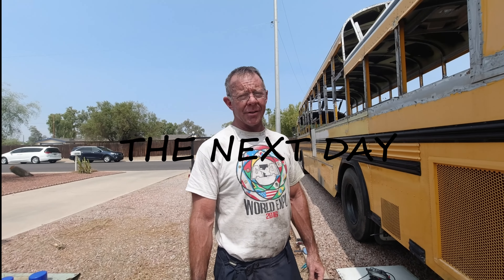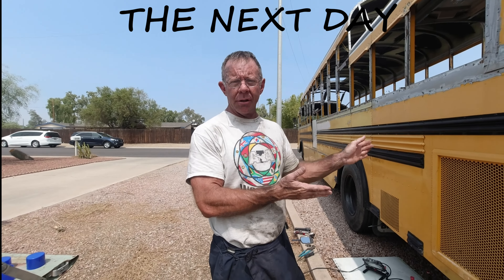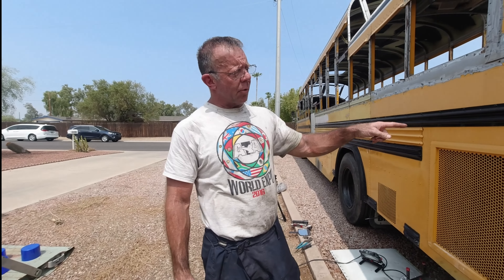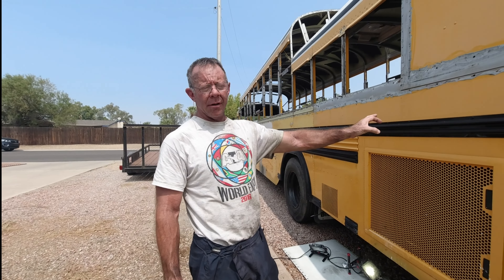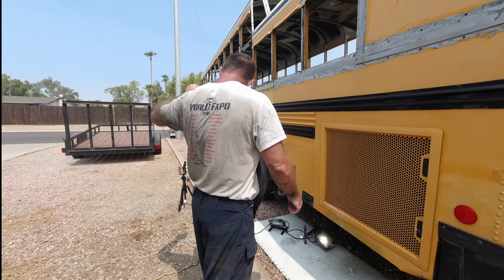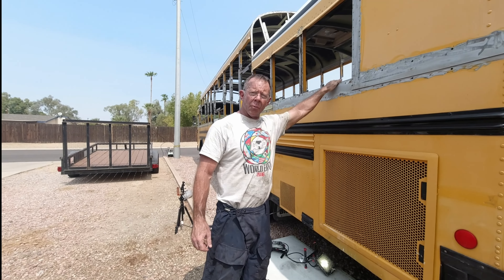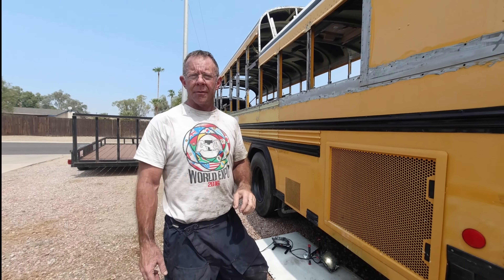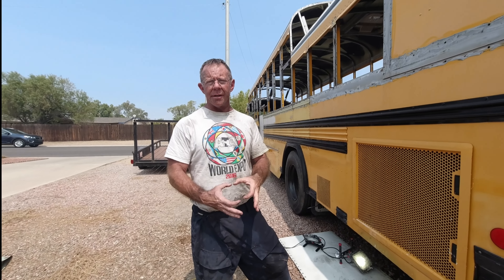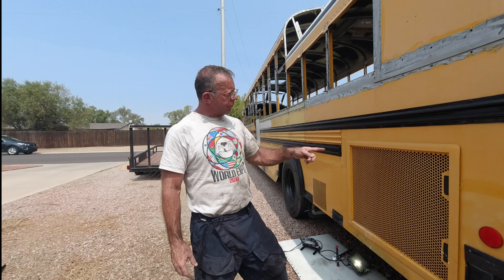It's Sunday morning, not so bright and early. We've been working for hours now. So what we're doing is deleting the heater from the bus completely. We have to reroute the coolant line that went to the heater, went through the heater system, and then the return. We removed the pipe adapter — threw it in the trash already — so there's no more hoses inside and no more liquid from the engine at all anymore. We can patch the floor finally — weld it right now — put plates in place where all the holes were and fill those up, and we'll have a sealed floor.